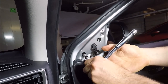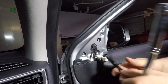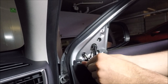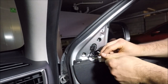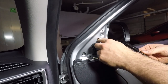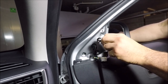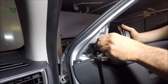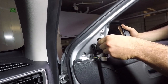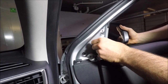Don't take them all the way off just yet. Now do the rest by hand — undo the bottom two first, then slowly start to undo the last one while getting one hand round on the wing mirror to start to support it. Take that all the way out and now start to pass the cable through.